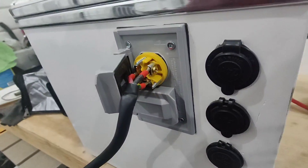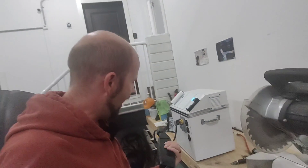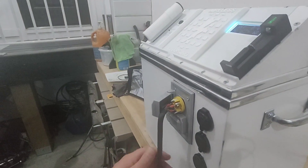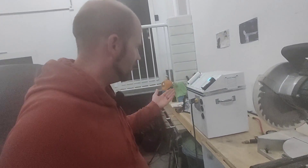Don't mind the weird mashup job plug that I just created there — that's incredibly dangerous. Don't do this at home. This is actually a 240-volt charger, so I had to quickly install a 110-volt capable plug. That's a NEMA 5-15 plug, but the charger itself came with a NEMA 6-20, which is a 240-volt connection. These chargers will actually work from anywhere from 110 volts all the way up to 240 volts.